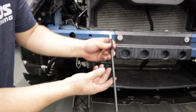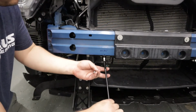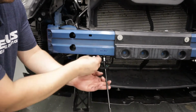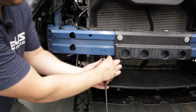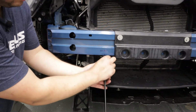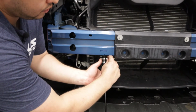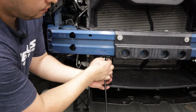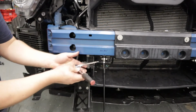So with that in mind, we're going to take our rod end and put it in the crash bar, or the clevis that's mounted to the crash bar, rather. And we're going to take a 12mm washer and our 25mm button head cap screw and install it through the clevis and the rod end on your splitter rod. And then you're going to take your M6 serrated flange nut and thread it onto the other side. You can obviously do this in any direction that you want. I find it easier to have the button head or the Allen portion facing the outside of the car, because just the nature of Allen sockets and Allen keys is you need a little more clearance to get into there.